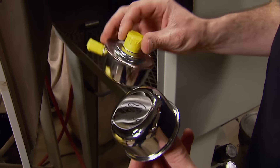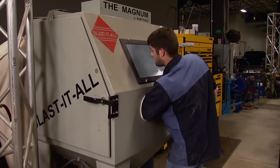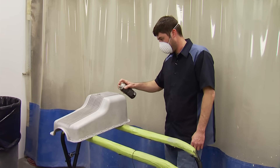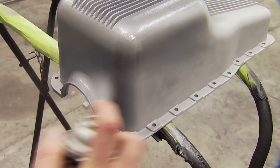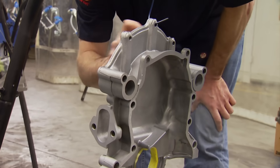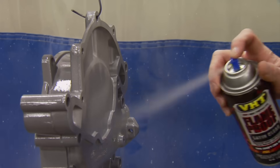Next, we're getting the engine tins ready. We remove the shiny finish in our blast cabinet to give them a rougher texture so paint adheres properly. True to the Rattle Can Rod name, the first coat going on is Duplicolor Silver Textured Metallic — it has superior metal and plastic adhesion, is fast drying, and easy to apply. A thin first coat followed by a heavier second coat gives excellent coverage, then VHT Satin Clear lays on top for protection — chip resistant and rated to 2,000 degrees.